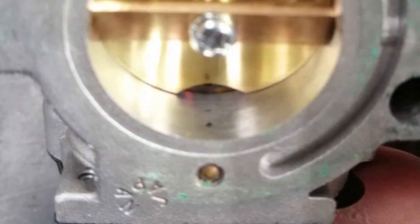My disc, as you'll see in the picture, is practically shut — there's only a minuscule amount open. That notch is immediately over where the idle part of the circuit is. In a WB3A carb, one of those three holes is blanked off because there's too much fuel. The notch dimensions will be in the description — it took me a day and about six attempts of slowly filing to get to the right size. If the hole is too big, you'll get a runaway engine where you cannot control the idle. Buy a second disc before you do this, because if you screw the first one up you can try again.